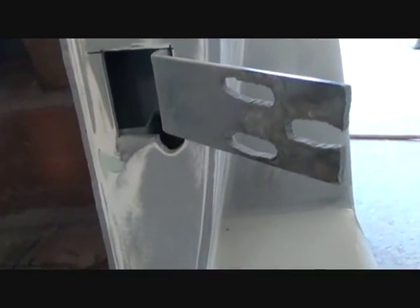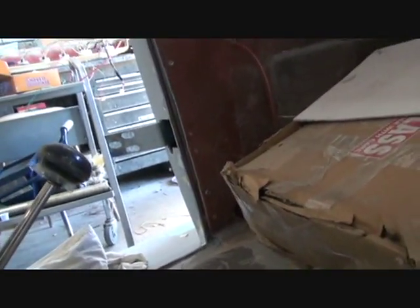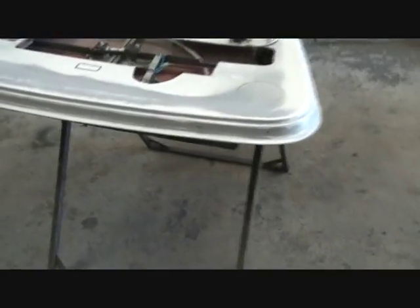So that's the way that you want to run your wires. You want to route them down through the body of the car just like usual. Run them down on the left side, run them over here, and make sure you give enough room where your wires will be up against the bulkhead or the rear of the floor. Then run them around so when you put your insulation down they're all tight and in the corners. Repeat the process on the right hand side door — you'll see that I've done that already. You can also run your speaker wire through here and come up — we're putting speakers in the wall and in the back bulkhead, so all the speaker wires are run. Everything will work out perfect and your wires will never get pinched or cut in half because of the hinge binding up in this area.